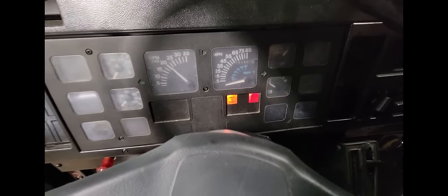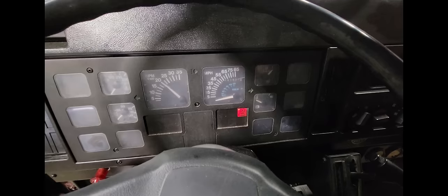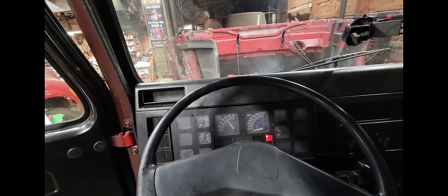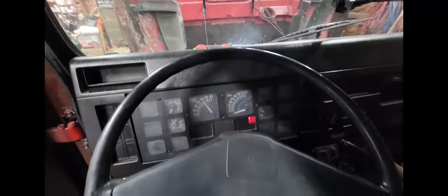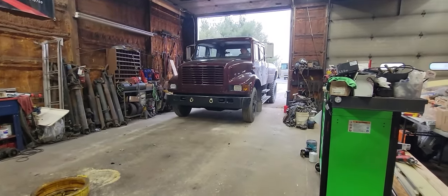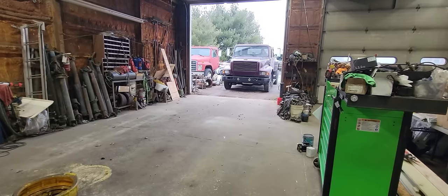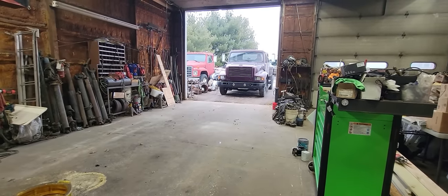Wait to start. Waiting. Might crank a little bit. We lost a little bit of fuel. Well, shoot, that ain't bad at all. Okay, well, we're going to check that solenoid one more time. We're going to put the air cleaner back in and get it outside, and then we'll try it again in the morning. Well, he didn't want to replace the batteries, and they're pretty low, so I guess we'll just have to jump it when we go to start it tomorrow and see if it's running good.